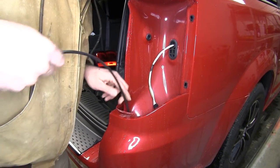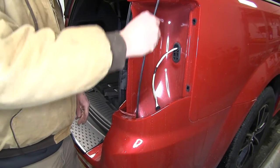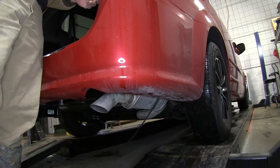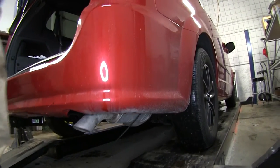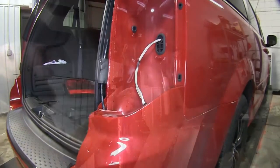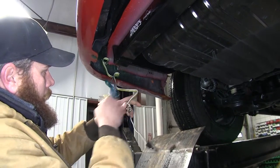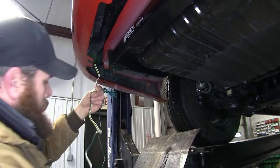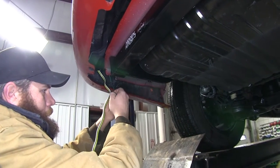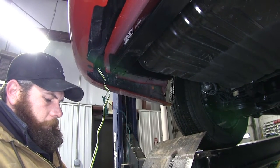You could use a piece of wire you might have, a coat hanger, anything. You just want to stick it down there and you'll see it come out the bottom side. Then tuck it in up here to hold it in place until we get our green wire connected to that. Now let's free up some of the slack from our green wire and get our four-pole a little more organized. Then we're going to start routing our green wire over towards the passenger side.